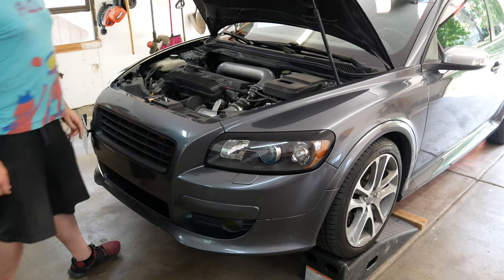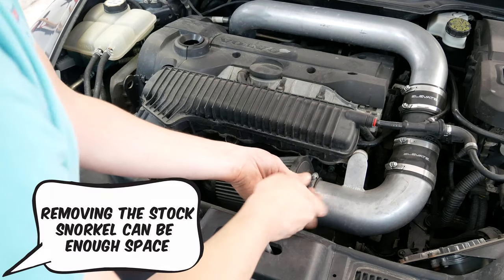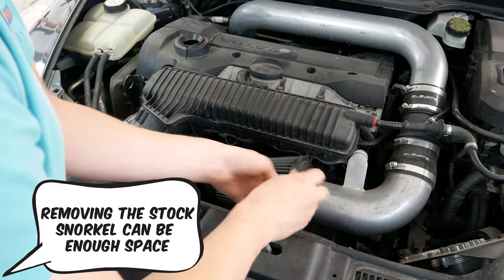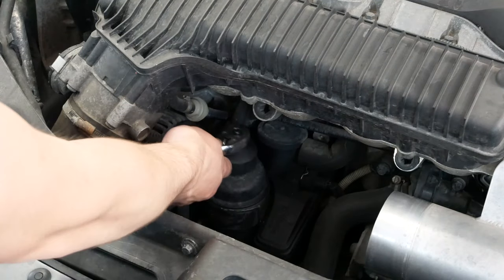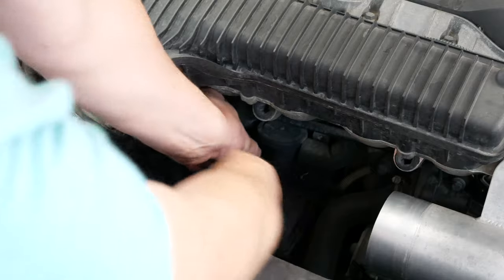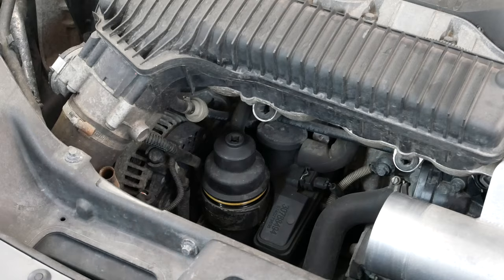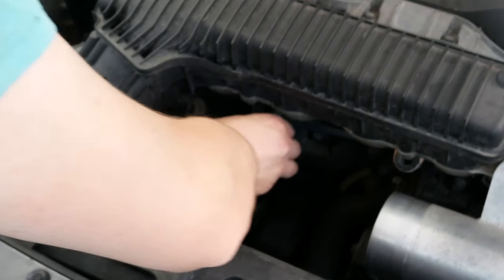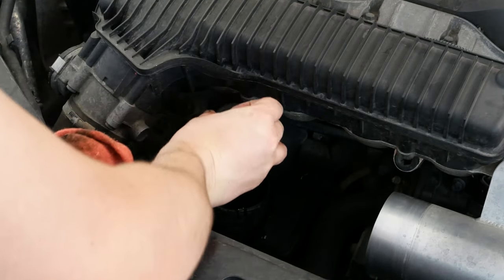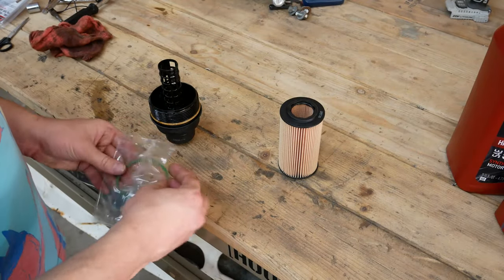The next thing we need to do is remove the filter on our intake. On the stock intake you want to take the box out to get access to the oil filter. On my car it's a little bit easier — just taking the filter out. Next, get your 36 millimeter socket to break loose the housing for your filter. Get that screwed off, and make sure to have a rag with you as it's going to drip some oil and you'll have a little bit to clean up in your engine bay. It's not always the cleanest to take out.